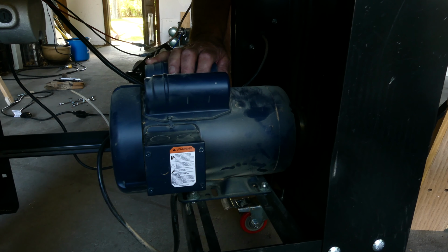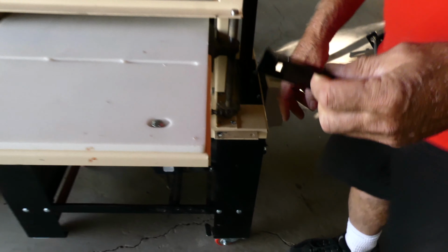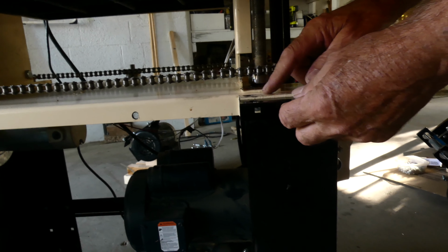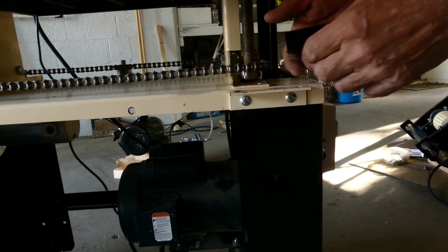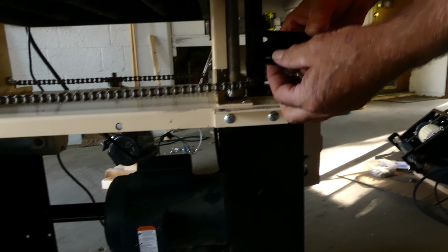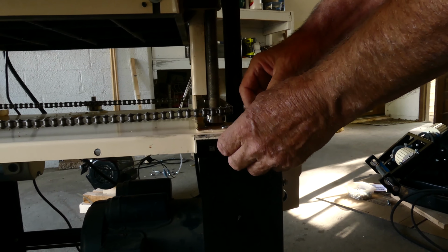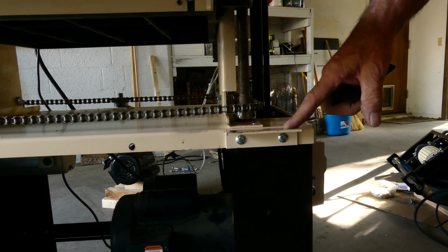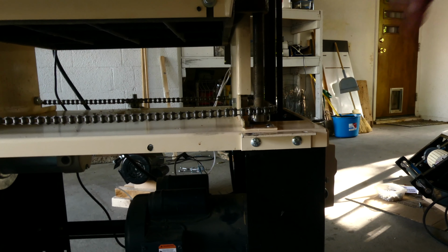This is your bottom mount bracket. As you can see, there's square holes, round holes, and what you'll need to do is when you come down onto the frame, I've got my old mounts on there, but all you need to do is use carriage bolts with the square head, it'll just bolt right on there, and you'll be ready for your bottom mount to be set.